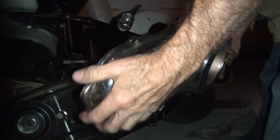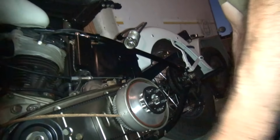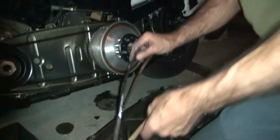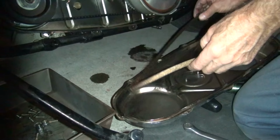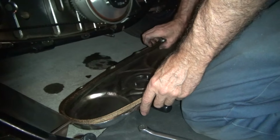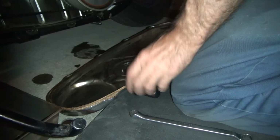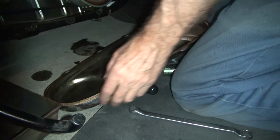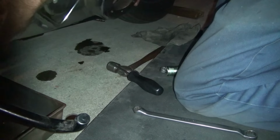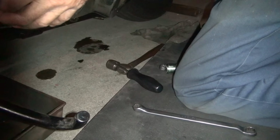So anyway, at least now it's working better. We have the free plate back in it. And where's the gasket at? I think there's supposed to be a gasket in there. So I'd put the Barnett Scorpion clutches in here and eliminate these problems, because now the basket doesn't move anymore. It fixes to the hub. It's fixed. Remember, you're not getting full travel because you don't have the right components on this bike.